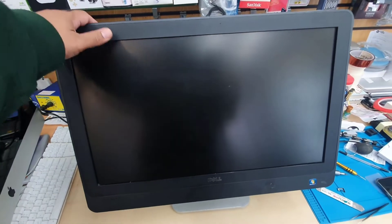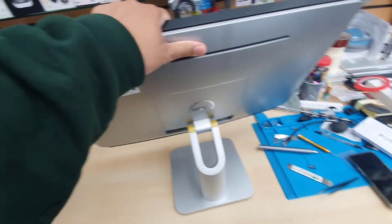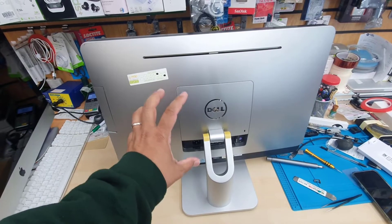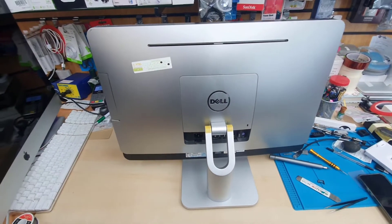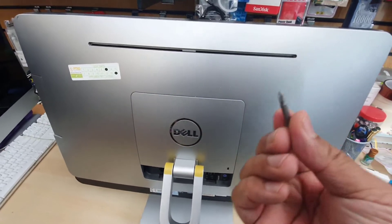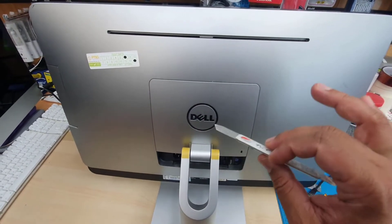This sort of all-in-one PC does have a 3.5 inch SATA hard drive, which makes things very slow. We need to take out the back cover, then pull out the back panel by removing four screws. It looks pretty hard, but it's super simple, and we don't need many tools except a Phillips screwdriver and a flat opening tool.